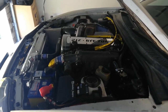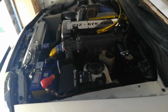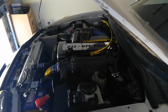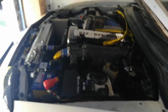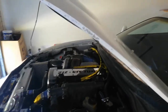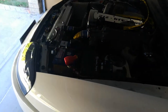The engine is running really nicely and is good on fuel. Other than a power steering leak, I don't have many issues anymore. I might re-tension the throttle springs just a little more, but I don't want to stretch the throttle cable since it's already hard to push. My throttle cable adjustment in the engine bay is almost at its limit, so I might have to adjust it at the pedal end. I'm at full throttle almost every time I drive — on ramps and through the gears.